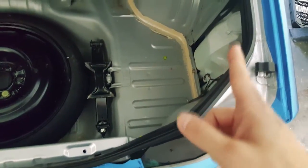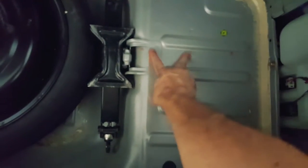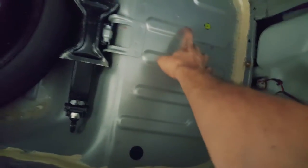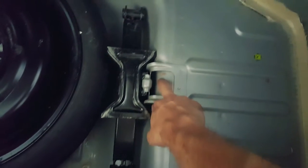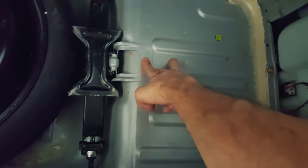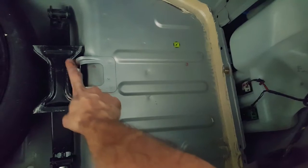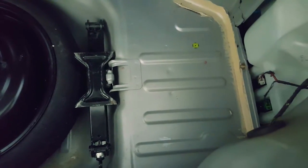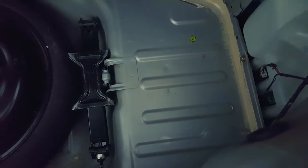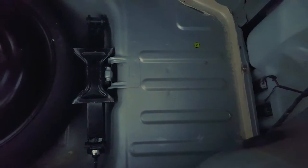Now what I'm going to do is get my drill, drill out the two pilot holes, get the box all set up, and then start routing the wire. I went under the car and made sure there's nothing I'm going to be drilling through — right here there's a frame rail that runs from here all the way to the front. This area is clear, it's just a flat metal tray. Right under here is where the exhaust is. This part might be a little weird to drill because it's at an angle, but there's enough room to not hit the frame rail.